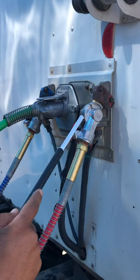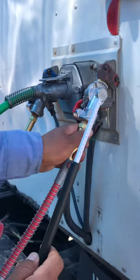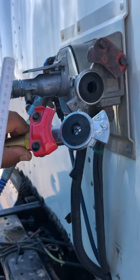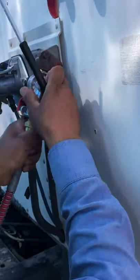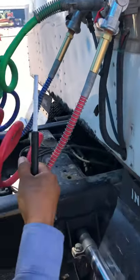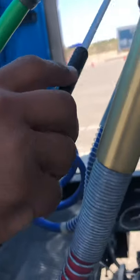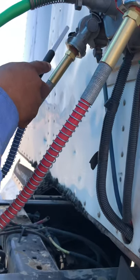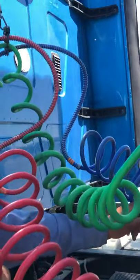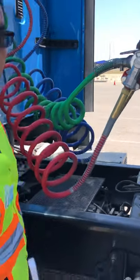Now let's check the trailer side. The dummy coupler should be properly mounted and secured and it should have a rubber seal in place — make sure it's properly connected and latched all the way. This is the emergency line — make sure there's no pressure bulges, cuts, or signs of any leaks. This is the service line, properly mounted and secure. The glad hand is properly connected to the trailer and sealed in place with no audible leaks. It's not tangled and has no abrasion, bulges or cuts, and is not touching the frame.